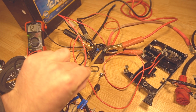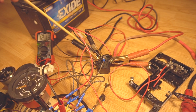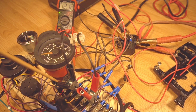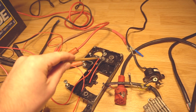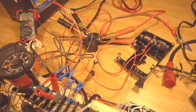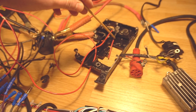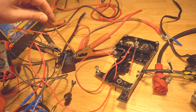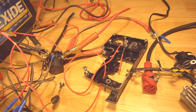Now I just want to explain how it's wired. As the power to the motor is connected here to the solenoid, this cable — red with a purple stripe — always has power. It goes through this 20 amp fuse and it is split into two ends. One end goes directly to the controller, so anything powered through the controller goes through the fuse. The second end runs directly to the engine patch panel. This protects the circuit — if there is anything crazy going on in your motor, any kind of shock, it will protect your main devices. There is also another red wire that runs to the solenoid but is not protected by the fuse. For example, the trim motor is connected directly to the solenoid and does not go through the fuse, but the button for the trim does go through the fuse and protects the electronics.